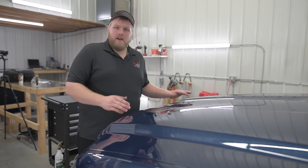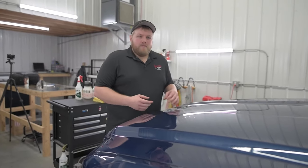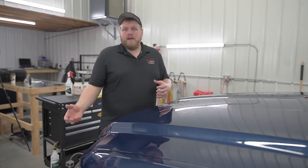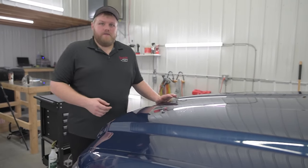There are a lot of common misconceptions out there that if you remove paint protection film, it's going to pull the paint with it. But if you take this precaution like what I just did, unless there's been a repaint, you should never have any issues with removing the film. Thanks for checking out the video.